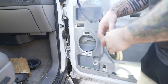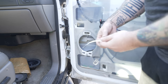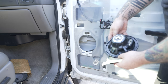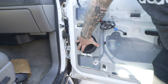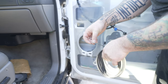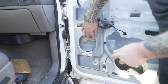The second thing you want is something like this — a roll of single-sided sticky foam. It's very thin, about 10 millimeters wide, and it's basically a foam that's going to go on the back of your new speaker all the way around the edges. What that does is when this speaker is sealed to this door, instead of it being metal on plastic, you have this thin foam barrier in between that's going to prevent rattling if anything comes loose, and it also provides a better seal around the back of the speaker to the door.